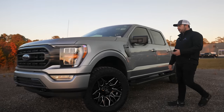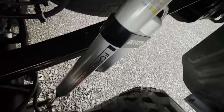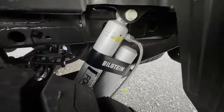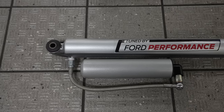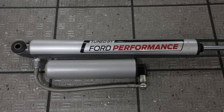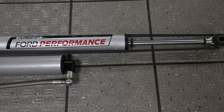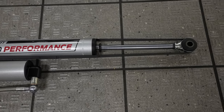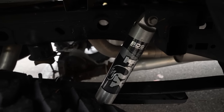There's a big difference on the rear for these two kits as well. Both kits give you new rear shocks, but on the Ford Performance kit you're getting the Bilstein shocks with remote reservoirs. You're going to get increased travel with that and a more sustained ride quality, versus the Fox kit which just has a single shock absorber in the rear.